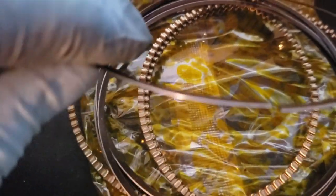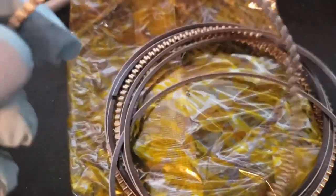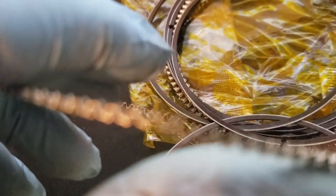We're ready to put our piston rings on. I'll start with the oil control ring. There'll be one support rail on the bottom, then the oil control ring expander which is the groovy one, and then another support rail on top of the expander. One important thing to note when you put in your expander or oil control ring: make sure the ends are butted and not overlapped. You want them butted inside the piston — not overlapped.